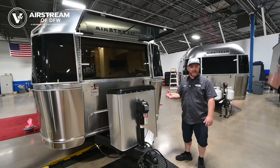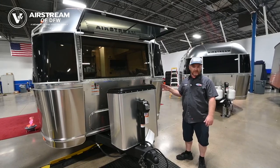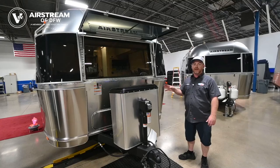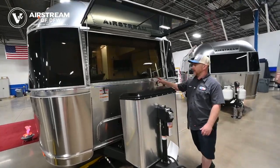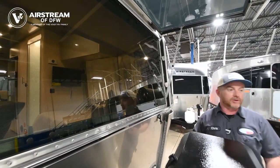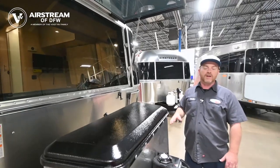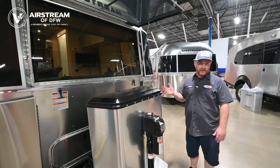All the rest of the windows that open can just be opened from the inside — none of them are blocked except for the front center window. I do want to mention that they tend to stick to the rubber gaskets, especially in the summertime. If you've undone the latches at the bottom of your windows and you're pushing on the stalks on either side and the window doesn't open readily, do not force it. Come outside and free it with an old credit card, a plastic scraper, or maybe even the end of your finger.